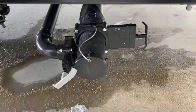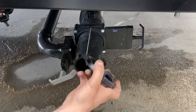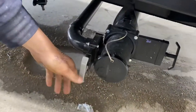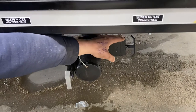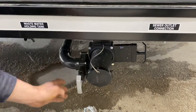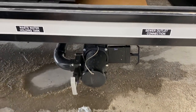Below that, we've got your sewer system. Press the cap in and pull it off — it's got the same ears as your sewer hose, so it attaches the same way. Press it in, give it a turn, and it clicks in. On the left you get a gray valve controlling your gray tank, and on the right a black valve controlling your black tank. Your black tank is filled from your toilet, so that's your dirtiest water — dump that first. Then the gray, filled from your sinks and shower, is typically cleaner water, so dump that last to help keep the hose as clean as possible.